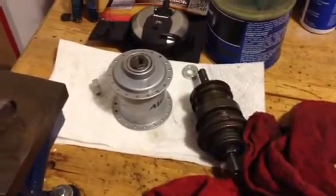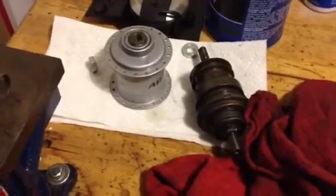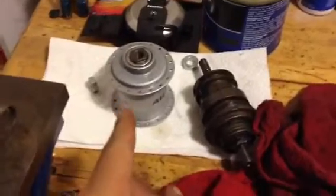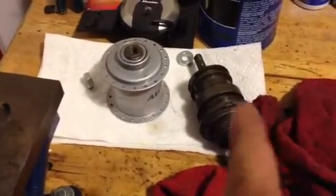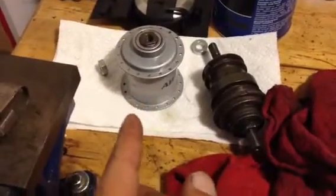What you are looking at is the outer shell of a modern Sturmey Archer AW freewheel, 3-speed, and the innards of a 1970 AW 3-speed. This hub had a long enough axle, and since I didn't have any spare axles available, I took the innards of the 1970 hub out and the innards of the new one out, and switched them onto this Flying Pigeon bike. So here is a 40-hole 1970 shell with the brand-new AW 3-speed hub innards inside of it with a longer AW axle.